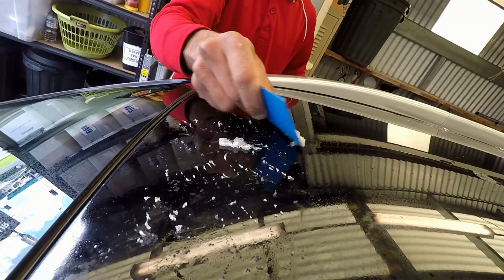We'll clean all the glue off, and then once all the glue is cleaned off, we can then give it a light machine polish. Now, depending on what the customer wants to do with the car, if it's just going to go and be sold and doesn't want their branding on it anymore, we'll do a very light correction on the paint. But if the customer has bought a car with stickers on it and wants to restore it to brand new, then you can start your different, 1, 2 or 3 stage corrections on the paint.